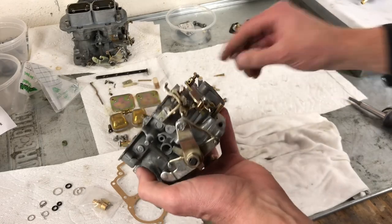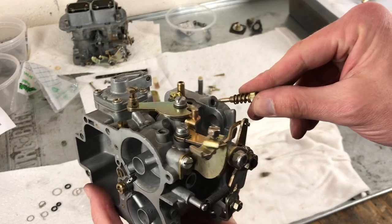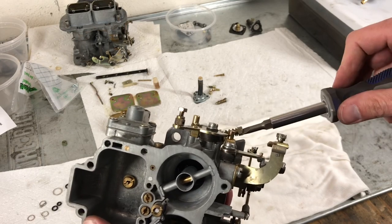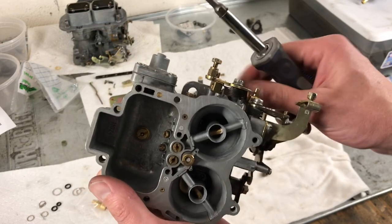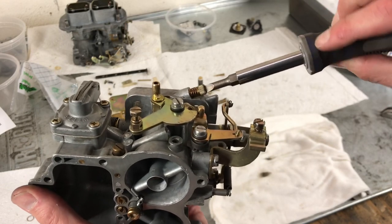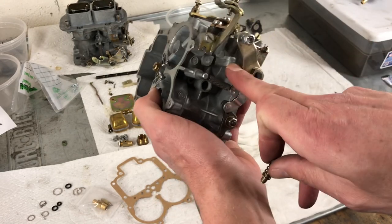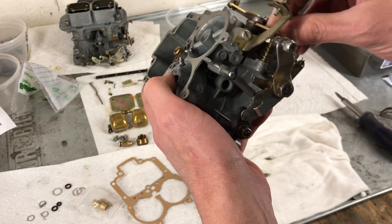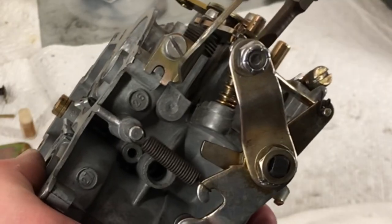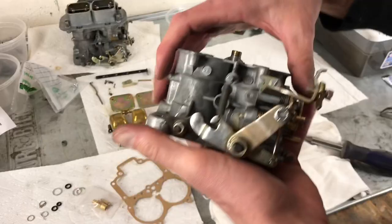Finally, we're going to install the cinch-down point for the choke cable, and that simply goes on the side of the throttle linkage. For the body, we're going to install the idle mixture screw, which goes right below the choke. We're going to tighten this all the way until it lightly seats, and then once we have that, we just back it out two full turns. Finally, the idle speed screw — that's going to sit right behind the throttle linkage, and we're going to screw that in until it touches this part of the linkage.